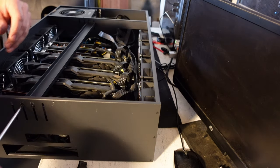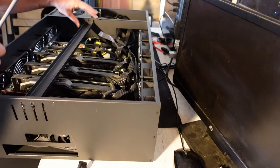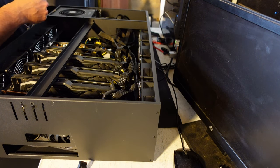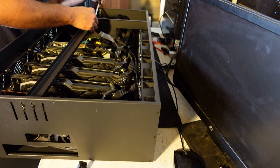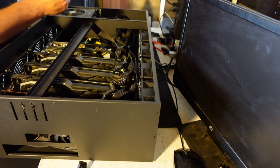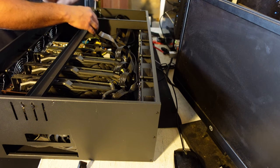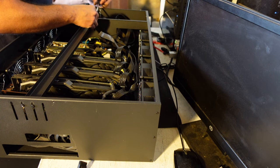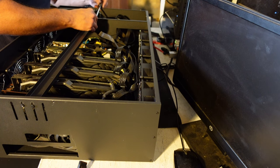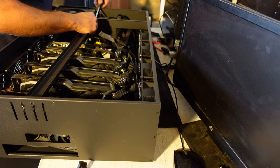You need low power. So theoretically, you could do this with a 3070 rig or a 3080 rig, but first of all, they have to be two slot cards max. Second of all, you have to have a really, really big power supply to do this, because you need 1600 watts probably, because you definitely will need to split the risers. Just like the other issue I had building that other eBay server case.